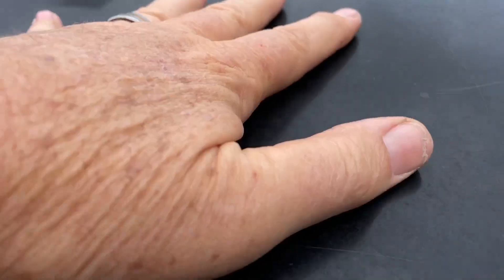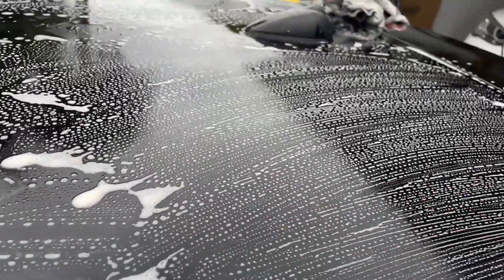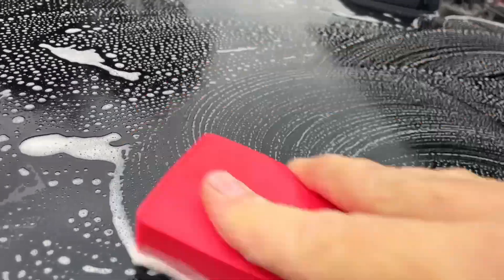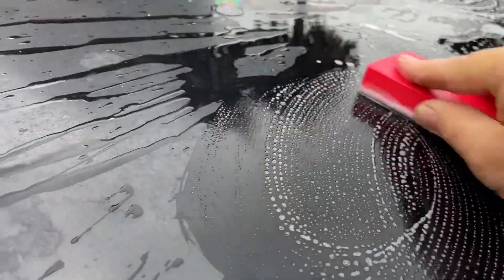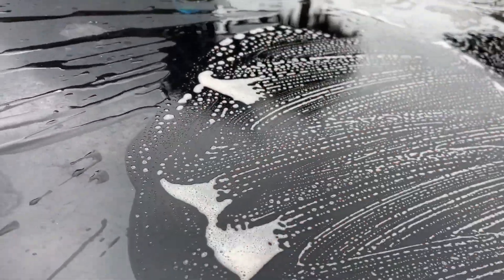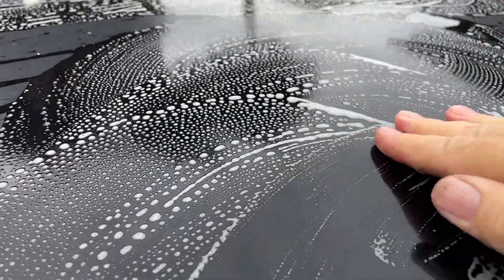You can feel all the dirt caught in that paint — and here it's totally different, smooth, all that dirt's out, so we can now polish this. This clay bar is working — can you hear it? That's really very very different to that. We'll clay the whole roof and then we'll get the big polisher out and see what we can restore. This side of the roof wasn't so bad and has responded really well. The clay is lifting the dirt out of the paint. If you listen — that's the good bit, and over here you can hear the difference. It's doing a brilliant job, pulling that dirt up. That's now got the paint out of it and it's doing well. I'm liking what I'm seeing.